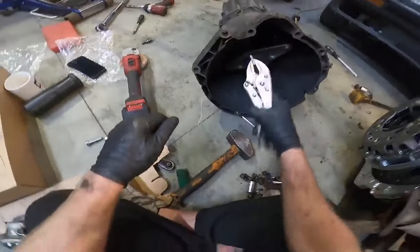We had custom power steering lines made that run all the way through the car, under the car, to the steering rack. So we now had fuel, ignition, brakes, and steering. The only thing stopping this car from driving was a prop shaft, so we had a custom one made. Going to first gear — let's hope the clutch works — and I turned the wheel. When I let go of the clutch: yes!